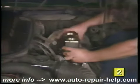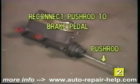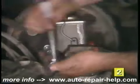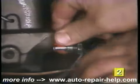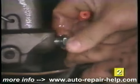Install the replacement master cylinder on the vehicle, making sure the push rod is correctly positioned. On master cylinders with permanently mounted push rods, reconnect the push rod to the brake lever on the inside of the car. Reinstall the master cylinder mounting nuts or bolts and tighten them securely. Remove the rubber hose and remove the brake bleeding adapters. Loosely install the brake lines to the master cylinder.